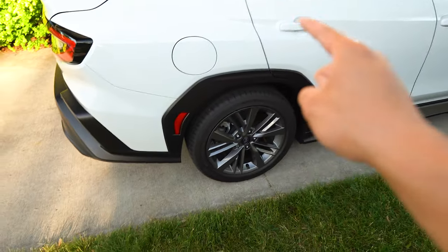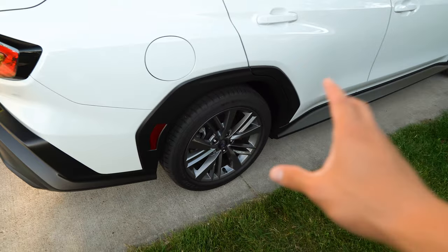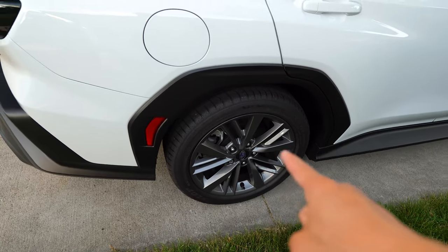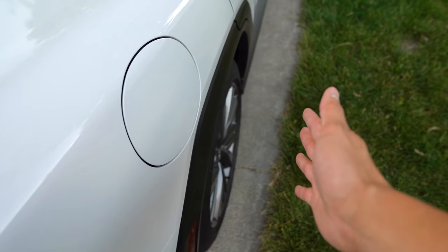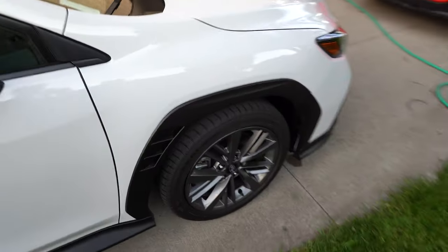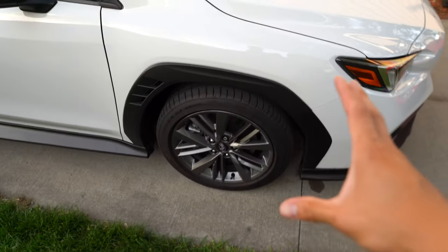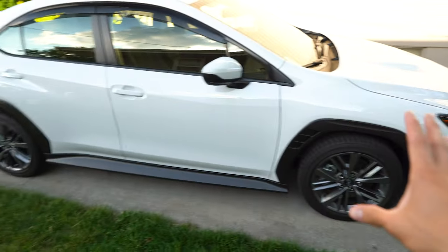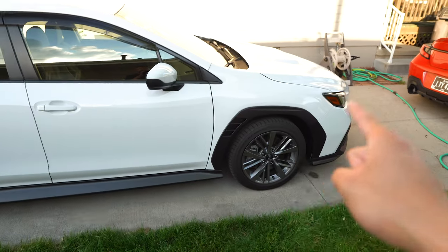The second thing we're going to take care of are these wheels. We're not installing aftermarket wheels quite yet — we're stuck with the stock 17s for a little bit. But what I hate most about the stock wheels is the wheel fitment. These are a 17x9 with a plus 55 offset, which means it sits really far inside the wheel well and it just looks sunken in there. Same thing in the front — you can see it just sinks in there. That makes the wheels look smaller and amplifies the wheel gap, so this car looks like a monster truck. We're going to get the car up in the air, get the wheels off, and install some wheel spacers.